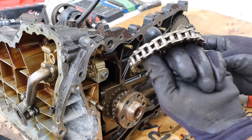This being a 5-cylinder engine, it has 6 main bearing caps for the crankshaft — a 4-cylinder would have 5, but weirdly a V6 only has 4. These are M12 triple square. Here's a cool thing: cylinder 1 is at top dead center and you'll notice cylinders 2, 3, 4, and 5 are all at different angles. That's because they have a 72-degree power stroke angle between each of them, as opposed to a 4-cylinder where cylinders 1 and 4 are in sync and 2 and 3 are in sync. They're at different angles relative to top dead center on piston 1, done this way so you get even power through the engine cycle — otherwise you'd have power pulses through the powertrain.